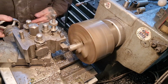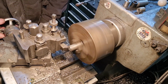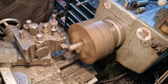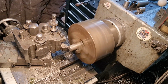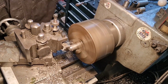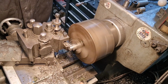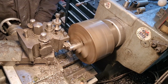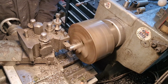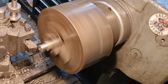Like so. Anyway, what I'm doing here is I'm making those top hat bits out of a bit of bigger stainless. Yeah, it's like 30mm on the OD, and we're going to turn it down in 2 cuts down to 12.5mm diameter and 12.5mm long, with an 8mm hole up it and a 2mm flange on one end. So I'll shut up, I'll zoom in, and you can watch me just finish those off quickly.